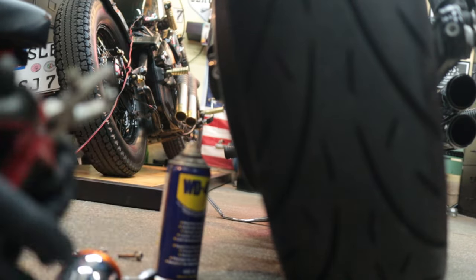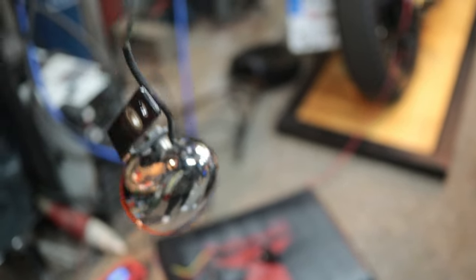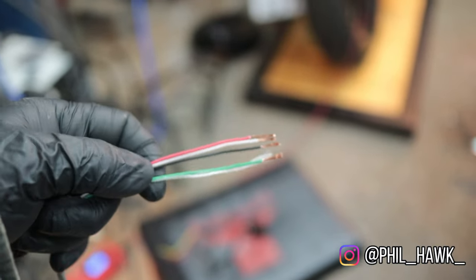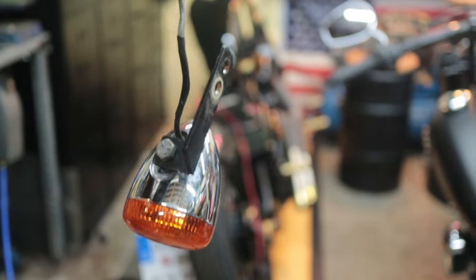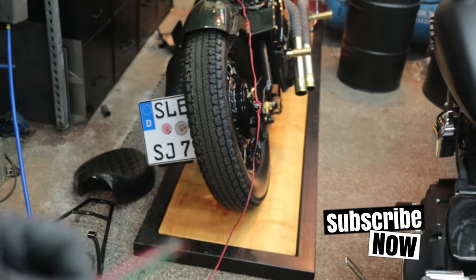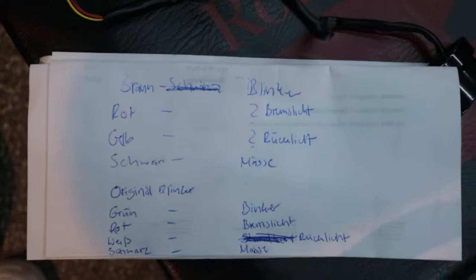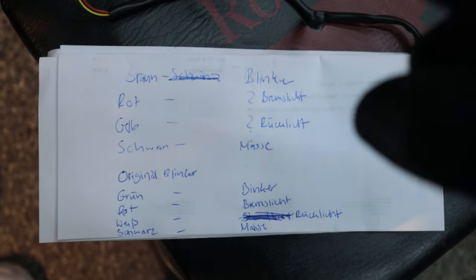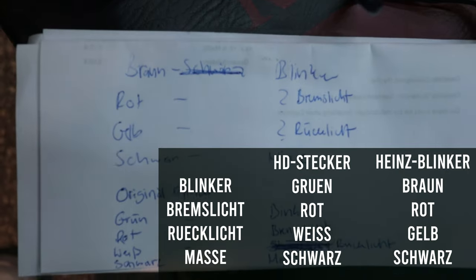Here goes on. This is now the old blinker — I'm going to quickly isolate the wires. That doesn't have to be perfect, just functional. I have now the old blinker isolated. Why did I do it? Just so I can hold the blinker here on the battery and see how the colors change — how the old blinker was wired. I'll note it down quickly so I don't need to do it here on the bike itself. I think this is the best version — note the original blinker wiring and the Heinz Bikes blinker wiring.